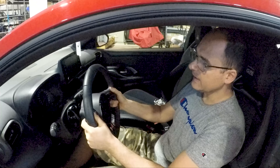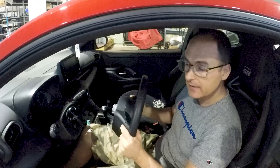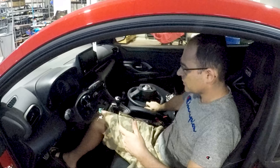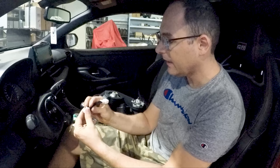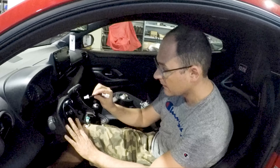For this reason it's mandatory that you always keep the steering wheel straight. Your wheels must be straight during the operation and you must not lose the straightness, because at the end you may re-put the steering wheel jumping a tooth and feel the car off alignment, and you will have to redo half of the procedure.